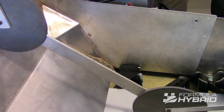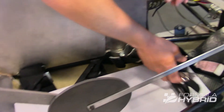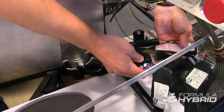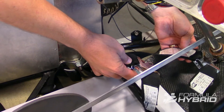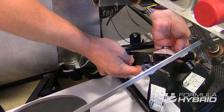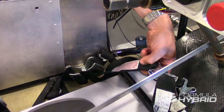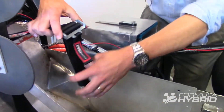If the driver is in a reclined driving position, then you must have either two sets of anti-submarine belts — one adjusted for your smaller drivers, one for your larger drivers — so that at driver change you aren't spending a lot of time adjusting your sub belts, as they take quite a while to adjust. Alternatively, you may have one set of anti-submarine belts, but those must have tilt lock adjusters, which you're much more familiar with as they sit on your regular shoulder belt.